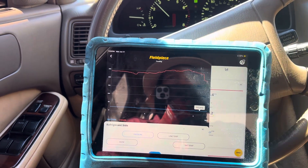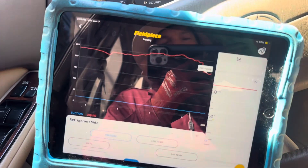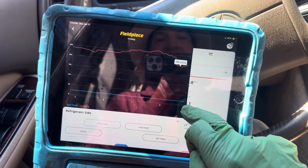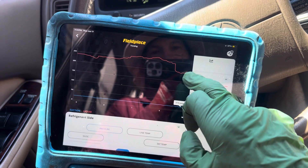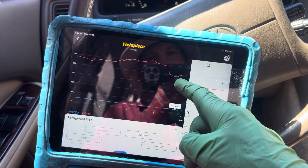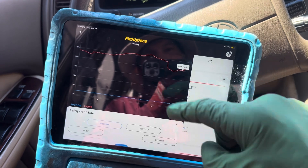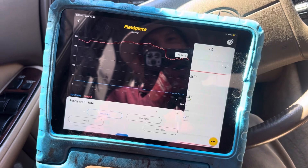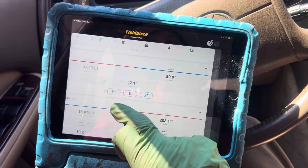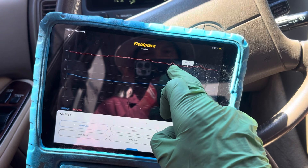What's happening here on the high side? We're doing some major drop. Let's get over here in the shade — let me zoom in and give you some clarity. We're down to 196 on the high side. What happened? Our low side didn't move at all — well, it went down to 17 — but look at our high side. That was probably our thermal fan clutch kicking in really well right there. Once it gets enough airflow over it, it'll cool down the bimetallic inside the center and it'll probably start swinging back up again. Our wireless Bluetooth probe in front of the condenser shows you when the fan kicks up and down.